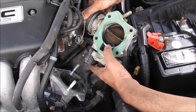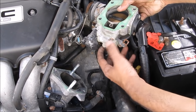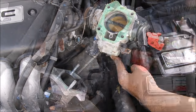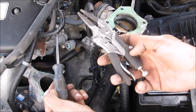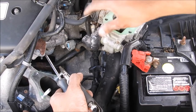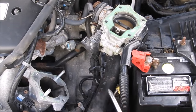Here's what the throttle body looks like from the back. We can open up the butterfly valve and clean it out with some carb cleaner. We also have access to the two Phillips screws that hold the idle air control valve. I've tried to break the screw free with a Phillips screwdriver and it just stripped out, and I've also tried a vice grip but it's slipping with the angle back there. So I'm going to have to remove the two coolant lines to get a better angle on those screws.